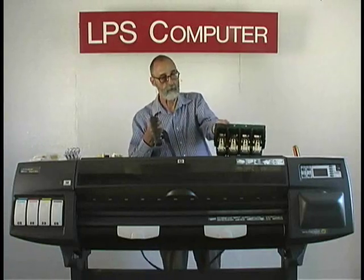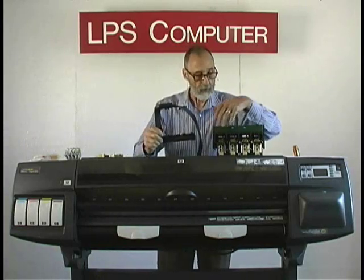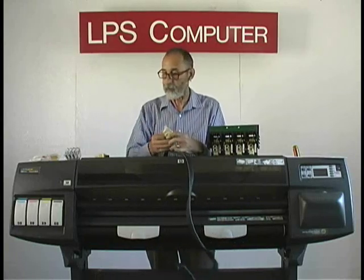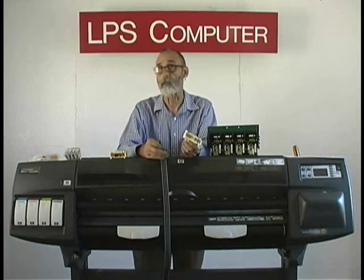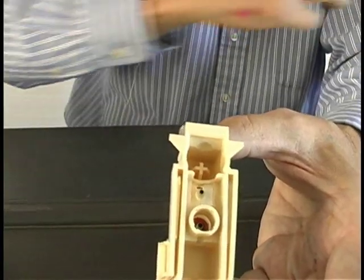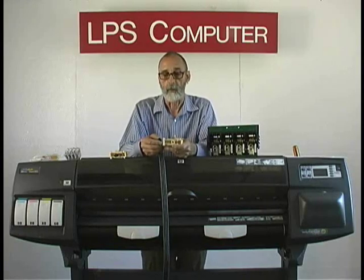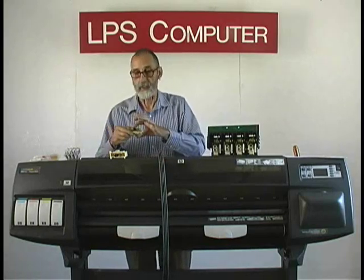This ink tube system is a refurbished ink tube system from LPS. I don't generally recommend use of refurbished ink tube systems unless they are from LPS. These have all been removed and the O-rings that shrink up and crack and leak have been replaced. We have a special device that we created to get these apart quickly and easily without breaking them. Then we replace the O-rings with a silicon O-ring which is not prone to hardening - it's different from synthetic rubber. It will maintain its pliability and its ability to hold a seal for many years. So these are completely redone and will not leak.